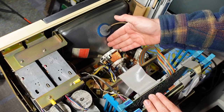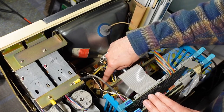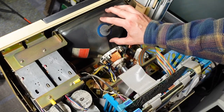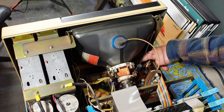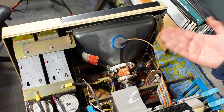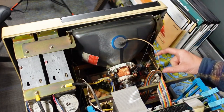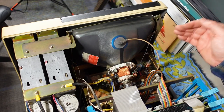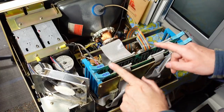Down in here is the CRT — it's an NEC branded picture tube. There's a transformer right here, so I wouldn't be surprised if this CRT actually runs right off mains voltage. The power supply is underneath the CRT chassis, so the CRT is going to have to come out — I need to remove this bracket and potentially four screws to lift that thing out of there, both to check for RIFA caps and to get that power switch out and repair it.